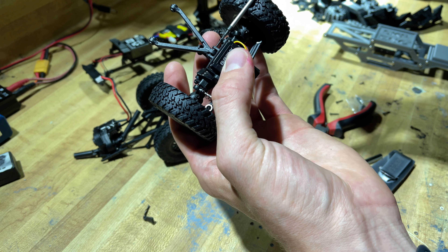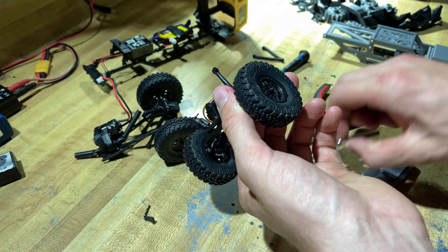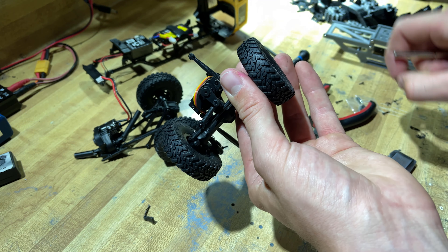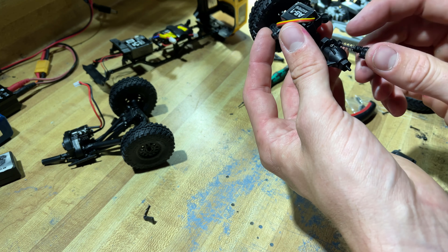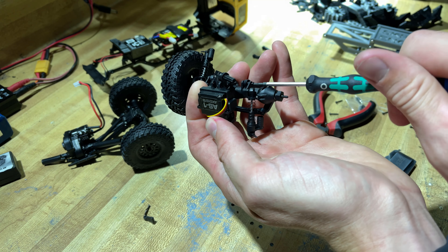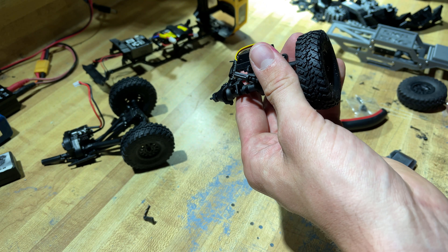This one you'll have to back all the way out because I believe both sides are threaded, so you've got to back it out completely. Now we're going to take our wheel nut wrench and remove the wheels so we can get at the rest of the mounts. Now what we're going to do is take these bottom links out of these holes here — the screws are the same way, just back them off a little bit, get your fingers in there and pull the bolts out.